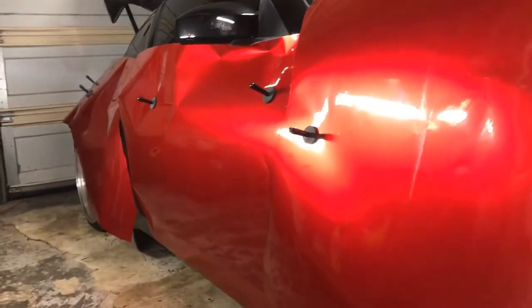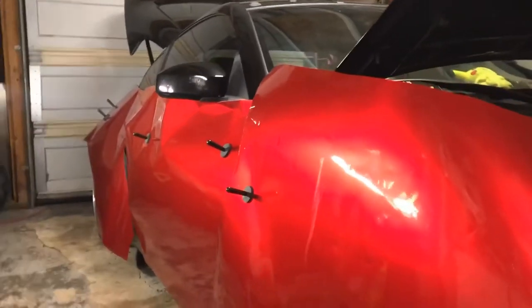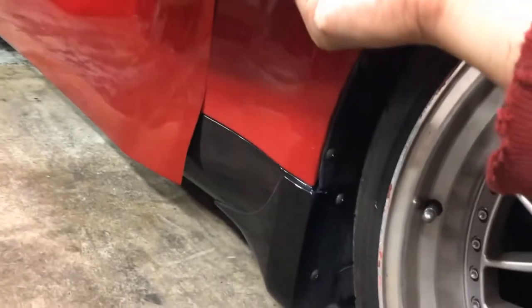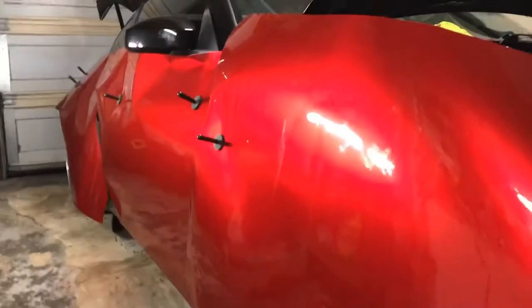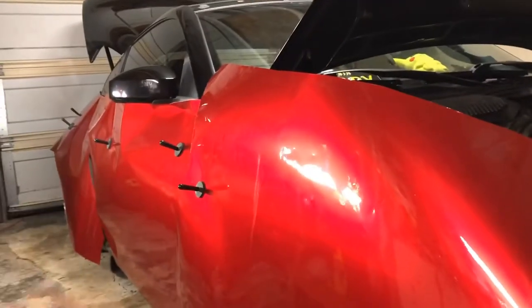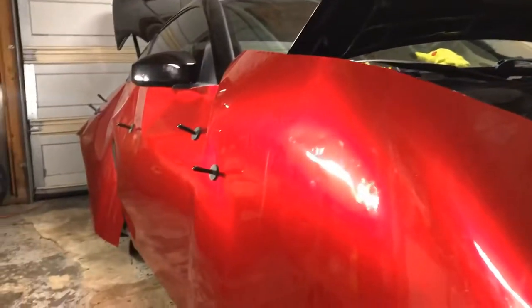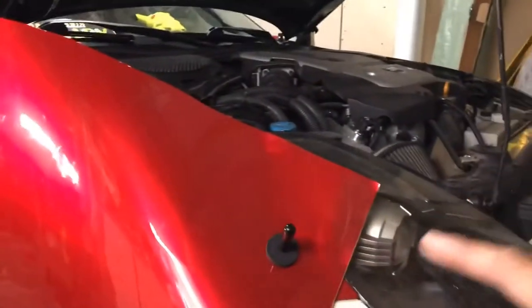The 350z is very nice — it's only 30 inches from the top all the way to the bottom, not including the little side skirt in black, which will have to be cut out as a separate piece. Because it's 30 inches, you can take a big piece of wrap — it's five feet tall, which is 60 inches — split it in half, and run it all the way from the front to the back of the car. I used about 160 inches or so.